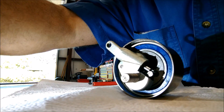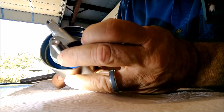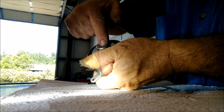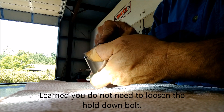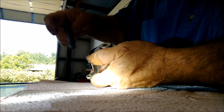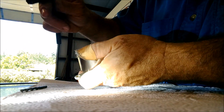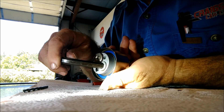Let me see if I can make this work here for you to understand. This is with the tensioner reassembled. You don't have to go through all this — just understand what the principles are. You're on top, you've loosened the hold-down. This is a little window we're talking about where you're going to insert your 5mm, or 3/16ths which is 4.89mm, into the hole. When you're doing this initially, it feels like it won't move and you can't figure out how the heck does this back off.